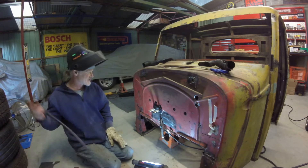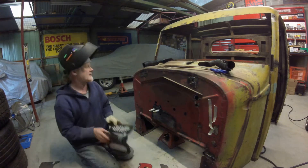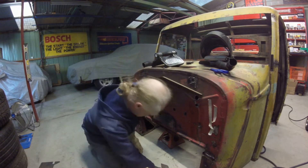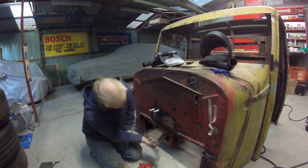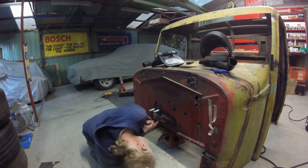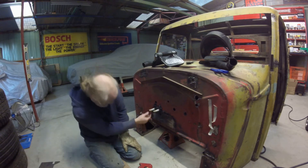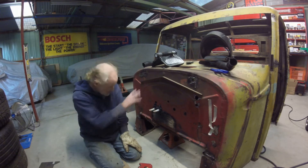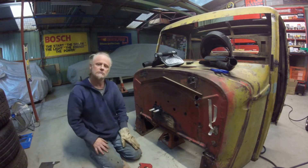Alright, that's it guys — that'll hold that plate in there for now. Next thing I've got to do is pull that heater box out and get inside, place this on the top there. Whichever way it goes, I'll clean it up first, place that on the top and then weld that in, and it'll all be boxed out again so it'll look neat. The bulkhead comes through exactly where I want it, got a little bit of space around it which is good. It'll have a half little bit of movement but once it's bolted in it'll be okay — nothing's going to rub.